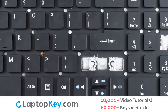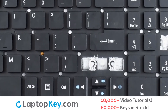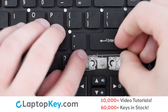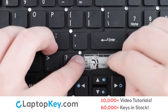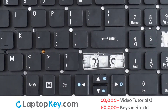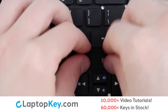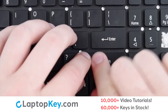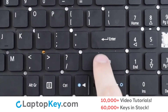To replace the metal support arms, there's a metal tab with a hole here and here, where you can insert the arms by placing one end in first, pushing to the side, inserting the other end, and laying it down flat. Repeat for the opposite end and make the arm lie down flat. Roughly line everything up, place your key cap on top, and you may need to move the metal support arms around just a little bit, but once they're in place, give a firm press all around and the key is functional.